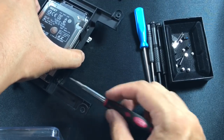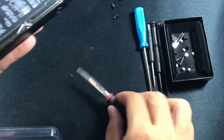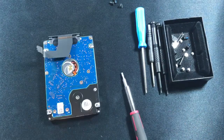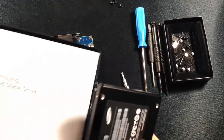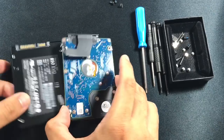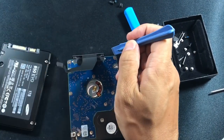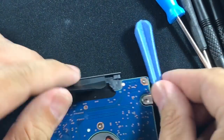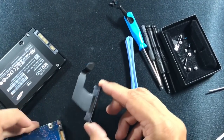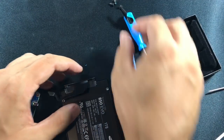One of the reasons I'm using a 1TB SSD is because I'm going to use it to run some Bitcoin nodes — several nodes for cryptocurrencies. I didn't want to use my main computer because of the wattage draw, and these Mac minis do pretty well on power draw. SSDs take even less power than their disk counterpart, and with a 5400 RPM disk versus an SSD there's really no comparison. By replacing the hard disk with an SSD it removes another area that generates heat. Because Apple never uses standard parts everything is proprietary, so we just reuse the SATA cable sticker and connect it onto the Samsung SSD.